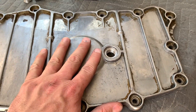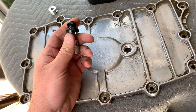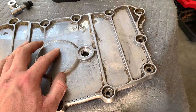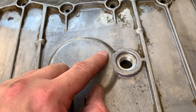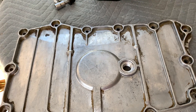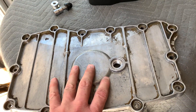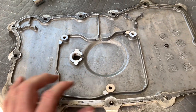What does all this mean? It means I almost blamed LN Engineering for something they didn't cause. The moral of the story is don't rush to blame the vendor — this problem is on me. More likely either me or my daughter hit the speed bump, bottomed out, and caused this crack, and it's been leaking for two years. I hope you'll find the time to drop your oil sump plate, because you never know if you might be dealing with a crack, some debris, or a more serious issue.